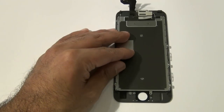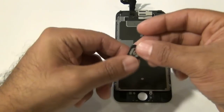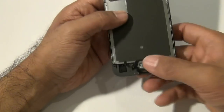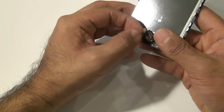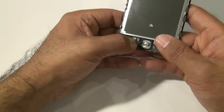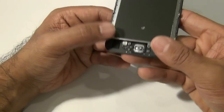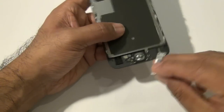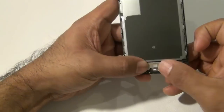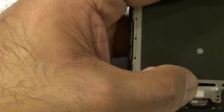With that in place, start working on the home button and flex cable. Place the home button into the circular hole at the bottom of the screen assembly. Once again, there are little cutouts on the flex cable — make sure they line up perfectly with the front screen assembly. Once perfectly lined up, plug the flex cable in with an easy snap; if you're having a hard time, take your time and make sure it goes in properly. Grab the bracket and note that one corner goes under the little shield, so make sure it's straight and not raised, then screw the three screws back in.